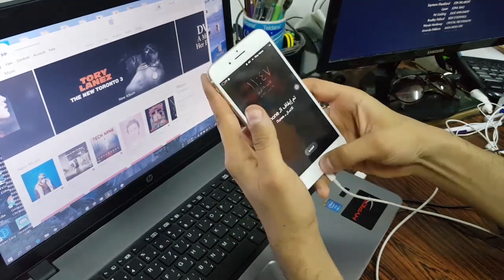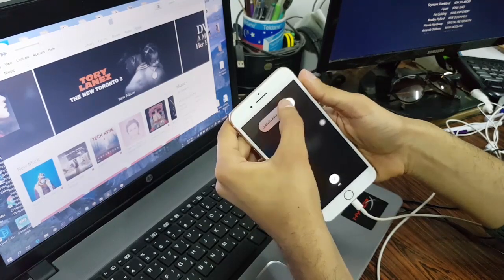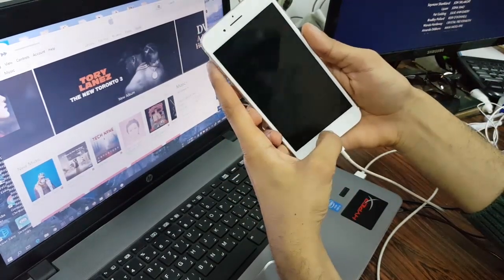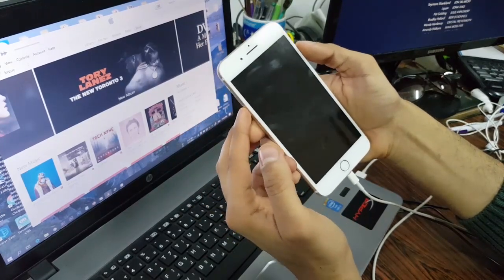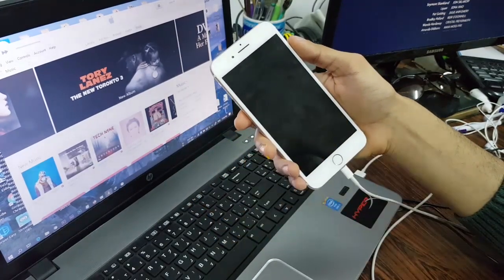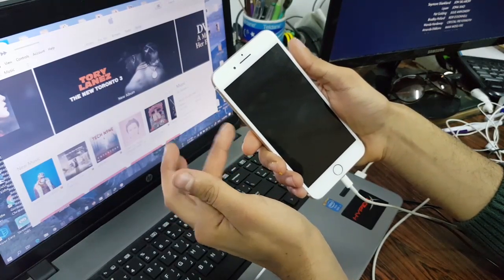We can't do anything, just emergency. So we're going to close this phone again, turn it off, and wait a couple of seconds. When the phone is turned off, we're going to use the volume down button and the power button. You have to do it right to get into hard reset mode — first press the power button for three seconds, then press volume down for ten seconds.